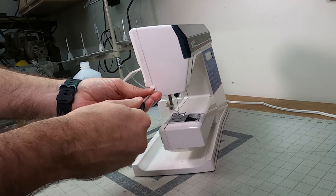This is either the first or last step, depending on when I remember to do it. I don't care how long it's been — it could have been five minutes. If you get a new machine, take that needle out and throw it away. Whatever was in there doesn't need to be in there anymore. Put a brand new needle in that machine. Clean the machine, replace the needle every time.